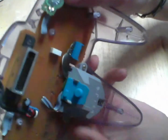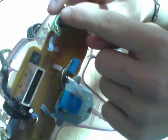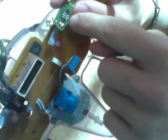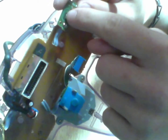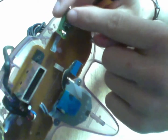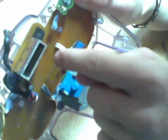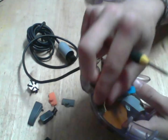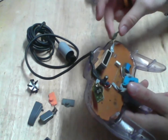I don't know how close you'll be able to see it, but you can kind of see the light green one up at the top there. That'll come around, follow the trace, it goes into this black stuff here, which you see in the middle. There's two black lines. This one that's coming from this black side goes up there, but it doesn't connect to this one. So when the switch is pressed, it connects both of those, and then it comes back up to this black one, over to this black circle, and back out to this other wire. So these two wires will actually be connected straight to the tact switch. So we probably won't even use these. Those will probably get cut off later. We won't do that now, of course, and because they can't be this close to the board, obviously those wires are way too short.